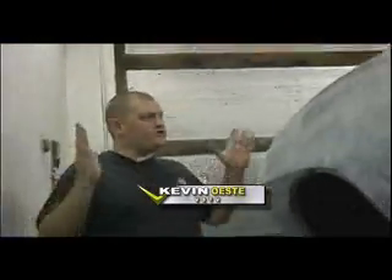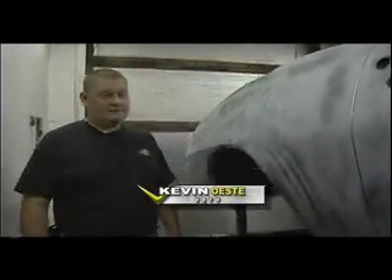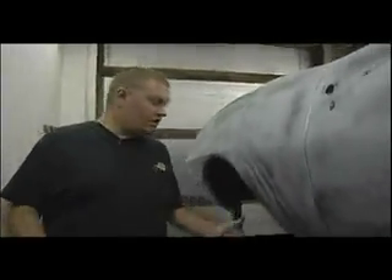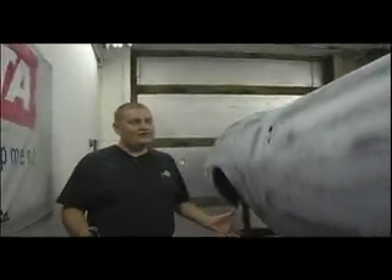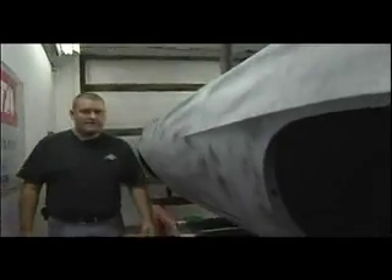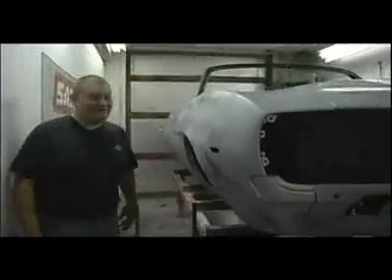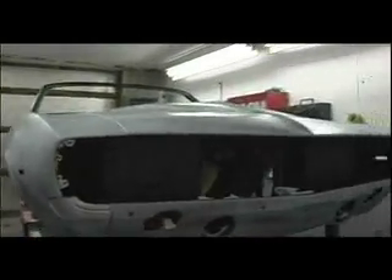It's late, it's getting cold in the Midwest, and the car is getting straightened out — final wet sanding before color. We reassembled the car up on the jig over the paint side, and you can see the guide coat sprayed across it, the zebra stripes. It's fitting very well, shaping up nicely. I want to shoot some color on this tomorrow.